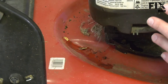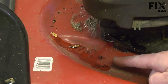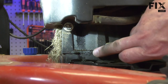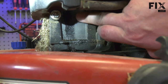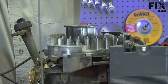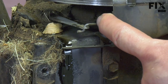Sometimes an oil leak will require you to disassemble parts of the engine to find the component that's leaking, such as this leak. We see evidence of oil leaking on the deck, but where did it come from? I'll start to trace that oil leak back to the base of the engine. Here I have oil up on the bottom of the crankcase. The oil goes up the side of the engine, so obviously the leak is somewhere on the top. To access an oil leak on the top of the engine, I'll need to remove the shroud, fuel tank, and blower housing. With the covers removed, I have access to the top of the engine, and I can see that our oil leak is coming from the upper bearing seal.